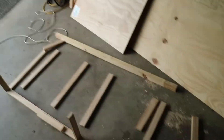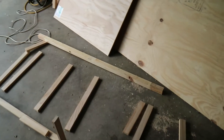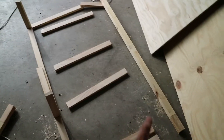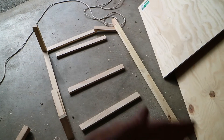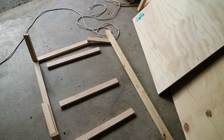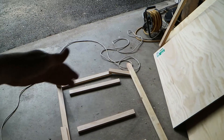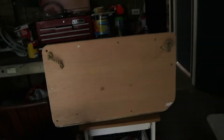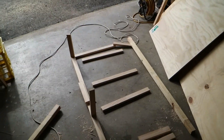Hiatus filming for a couple of days because I just had some really basic stuff to work out. What I'm doing at the moment is cutting out the bed frame - it's going to sit on the right hand side behind the driver's seat. It's very thin ply just to make a frame. I've got the bottom frame with four along here and then two corner ones, and that piece is going on top with four across as well, so that will hopefully slot straight in. I'll drill it into the floor and see how sturdy that is. I'm going to stain this tomorrow and stain the walls as well, then put the casing on and go to Clark Rubber to get them to make my mattress.